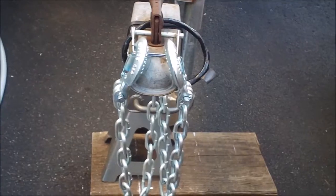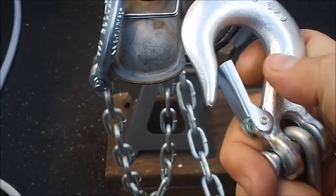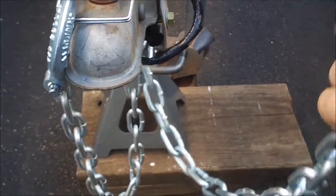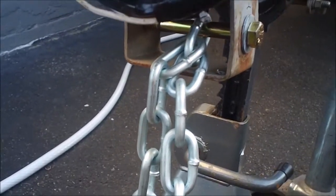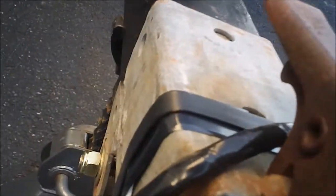Just like that, we've got new chains. You can see these have a little clasp here so that they won't fall off the D-rings on the back of my hitch receiver setup. The chain is pretty thick — I've got a hardened grade 8 bolt going through with a nylon nut, so that shouldn't back out or anything.